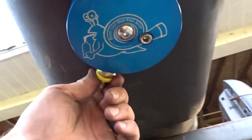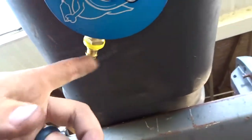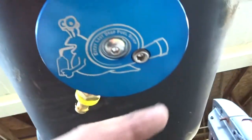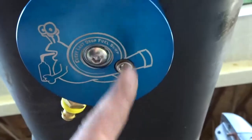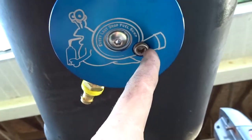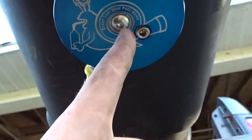This is going kind of angled so it can run out the side to the Air Dog on the frame. But if you didn't see in the video, there's a piece you fish in the bottom. This tightens up to that. There's an O-ring sandwiched on the outside of the tank, and then this here holds the inside. You gotta stick a screwdriver, Allen key, whatever, in that to hold it in place while you tighten here.